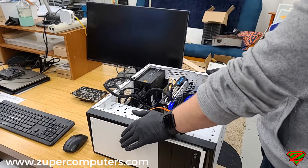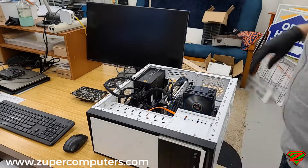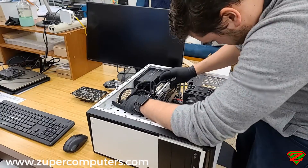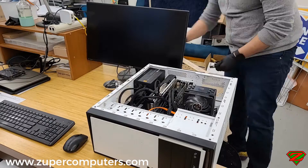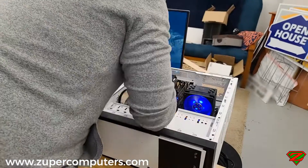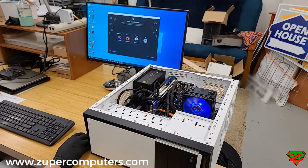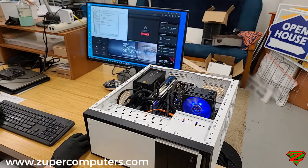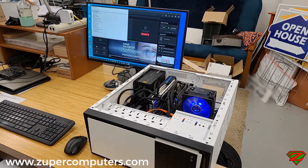Because this has a dual BIOS setup I had to do everything twice, since something wrong with the BIOS could cause an issue on each output. I verified that none of the outputs were giving a signal. Then I put my known-good graphics card into its working slot and put the Sapphire RX 580 into a secondary slot to see if the computer could even recognize it. When I opened the AMD software, Windows wasn't recognizing that there was a card in the PCI slot at all.